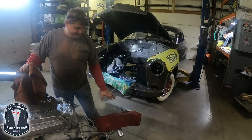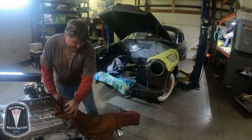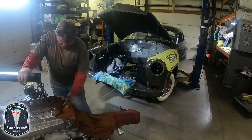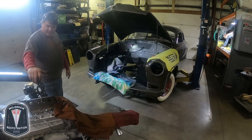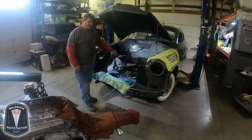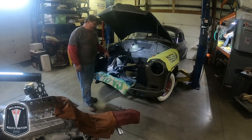We've got the cover installed here to protect the back of it as we install this, and I'm going to install one on the back of the engine as well, so in the event it bumps the firewall it won't scratch it. We're going to line it up and hopefully roll it right in. Since this is an eight-cylinder engine with all the accessories on it, we're going to move it to the passenger side slightly to ease rolling it back in and clear the alternator.